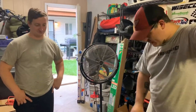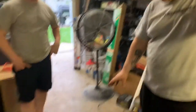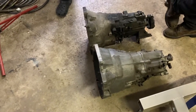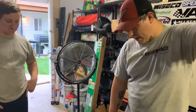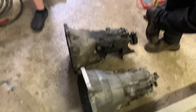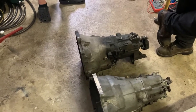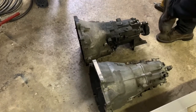Got the transmissions posted here. This is the old Getrag — they're known to be worse for turbo applications. This one's rated for 250 pounds of torque from the factory; the ZF is rated for 310. But these ZFs have been known to go well into the 600s for at least a short time, so I opted to go with the ZF just because it is stronger.